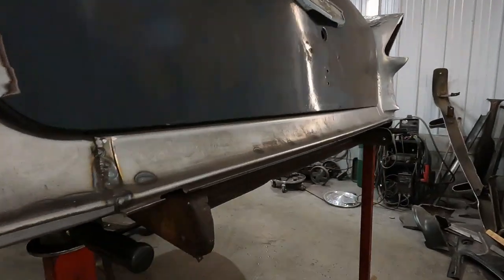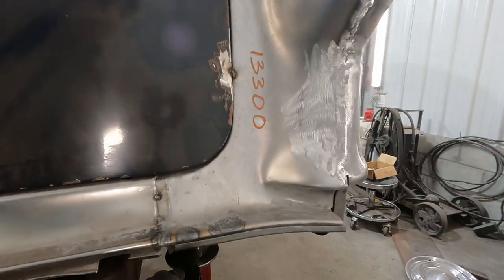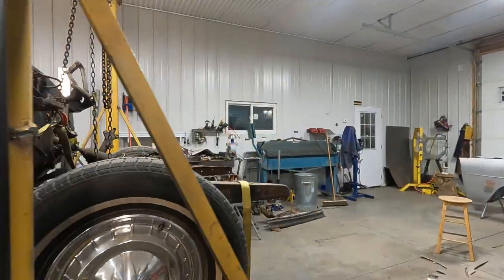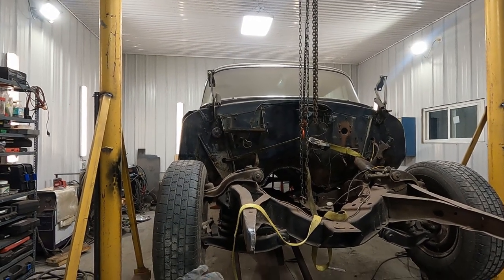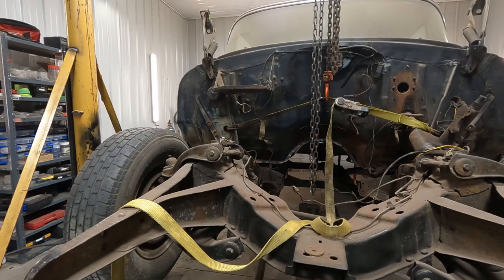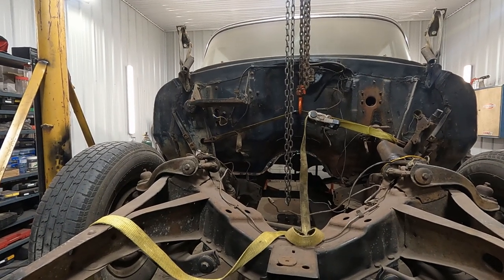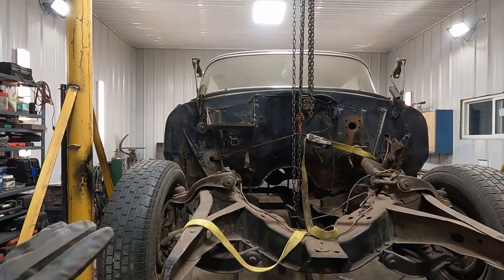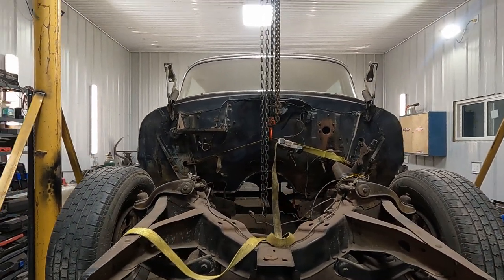There are two back here as well that I already got out — the bolts are just sitting there, not fastened on the bottom at all. I'm going to pick the weight in the front first and make sure everything looks cool before I start lowering the scissor lift. Sometimes this old scissor lift — it's an old Snap-on unit — it's not always gentle on that first initial lower. I just want to make sure I've got all the weight before I lower it, in case it jerks a little and causes a mess.